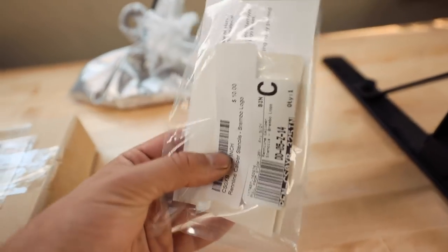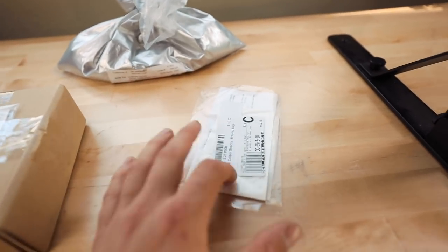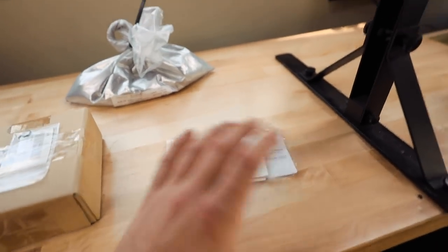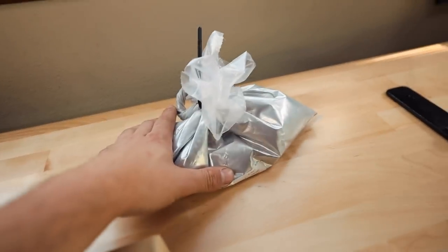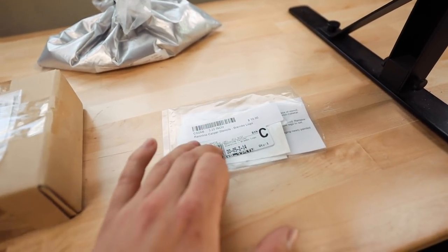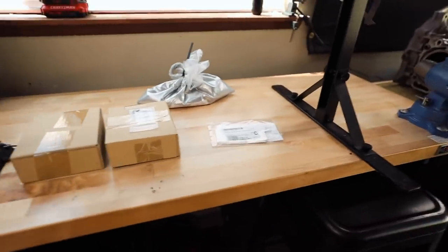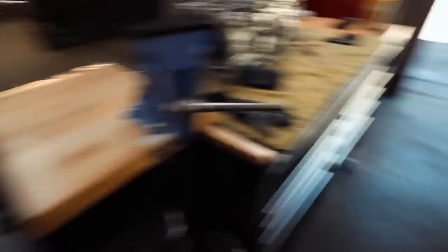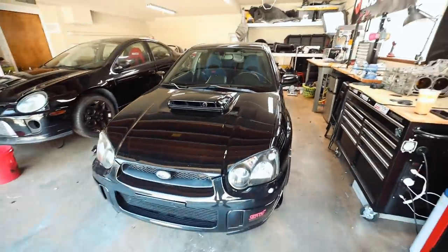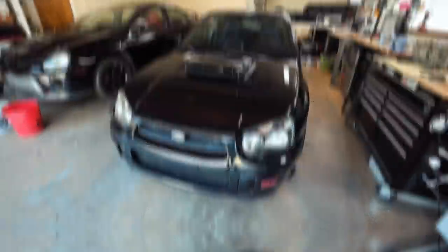The color we're going to re-powder coat these is Porsche silver — I think it'll look brilliant and perfect with the new wheel setup and the flares on the car. On Brembos, the Brembo logo isn't actually a sticker — it's painted or powder coated from the factory. So I have stencils in a variety of sizes from two inch to three and a quarter. The game plan: apply the silver base coat, mask everything, put the stencil on, powder coat the logo black, then clear coat everything.